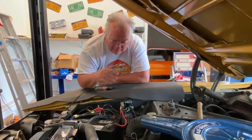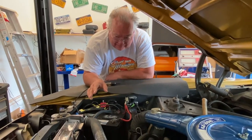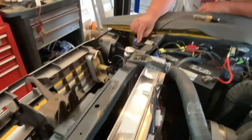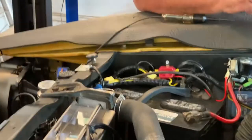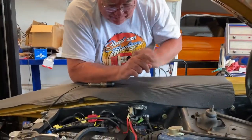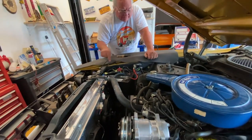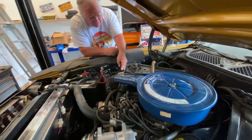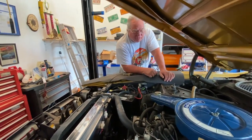This doesn't have a typical cooling system. In this case I put dual electric fans behind the radiator and we have an adjustable thermostat that controls when the fans turn on and off. Part of that system includes a wire that goes from the thermostat up through a conduit to an LED light group that shows the driver when power has been sent to the fans, so we can tell while driving if the fans are on or not.